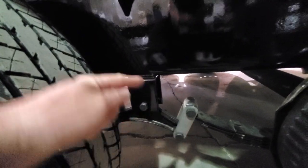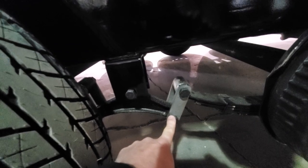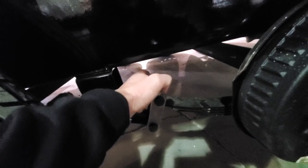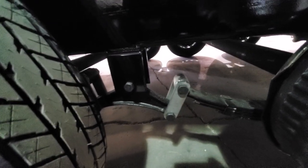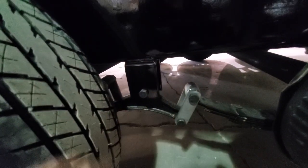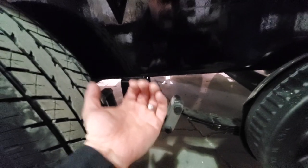On either side of the equalizer, front and back, these are called shackle straps. This is your mounting hardware. We had a recent update to service bulletins for tiny house foundation owners to put a little thread lock on the back side of these nuts, because one of our vendors supplied us with some nuts that didn't perform properly. We had a couple of trailers where this backed out, the bolt came into the tire, and caused some tire damage. Please refer to our other videos on our channel for that fix.